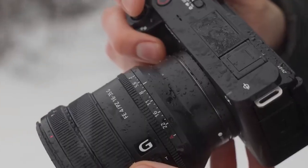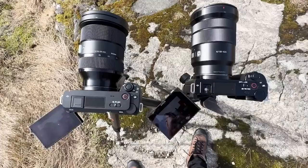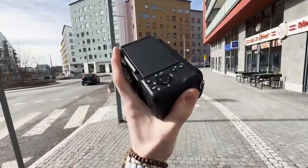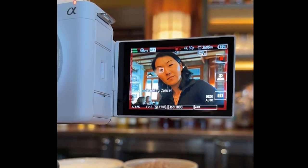A three-capsule mic array is mounted on top. Like with previous ZV versions, the camera comes with a wind-blocking adapter. Unlike earlier generations, the directionality of these microphones may be modified based on where you want to collect sound. There are front, rear, and automatic variants. If the camera is configured to identify persons and a human is in the frame, the auto mode will utilize the front-facing capture. When no person is identified or subject recognition is disabled, the all-directional mode is used instead.